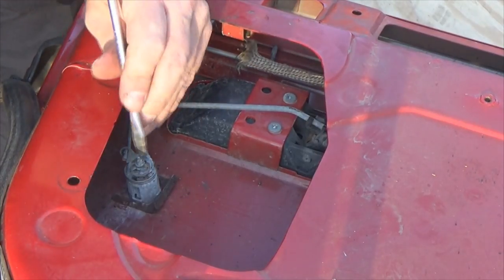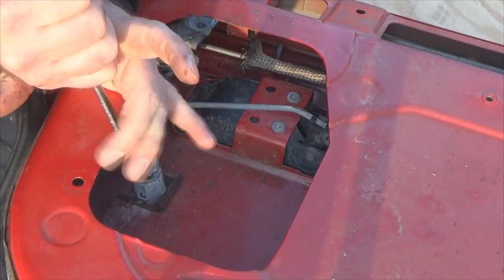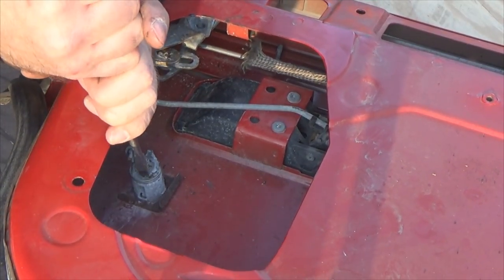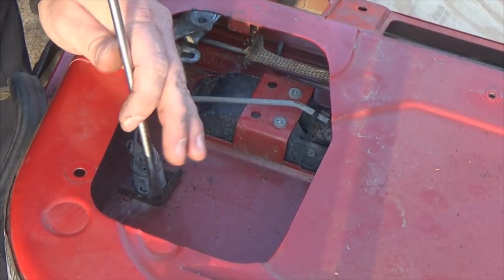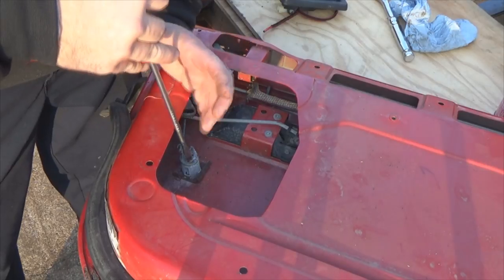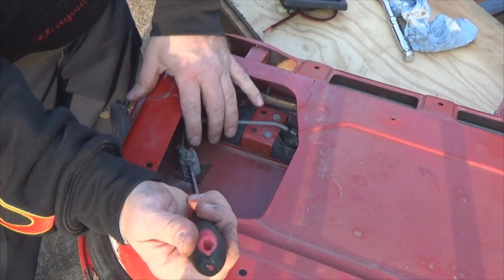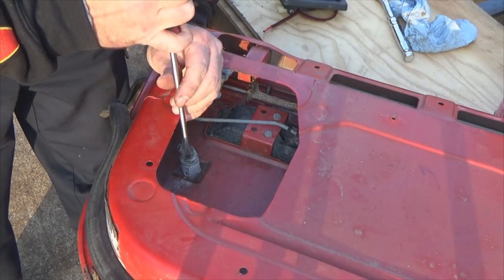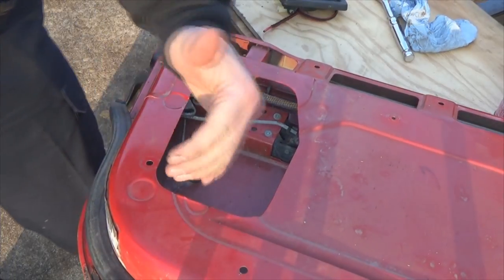The best way to put these e-clips in: put the edge of your screwdriver right against the edge of the e-clip, not the lock cylinder. Take your finger and push on it a little bit - these fingers here are doing the work, hooking here, and I pull with those fingers. If you try just pushing straight down, see how it's rocking my screwdriver? Versus stabilizing up top. The edge of the screwdriver blade is sitting right against the e-clip. If you get right here and try to push, you end up pushing the e-clip up this way and it wants to pop out and ends up who knows where. So just take the edge of your screwdriver, sit it right against that e-clip, take your fingers here, stabilize it up top, and just pull with your fingers. It snaps right in place because you get a leaner push on the backside of the e-clip.